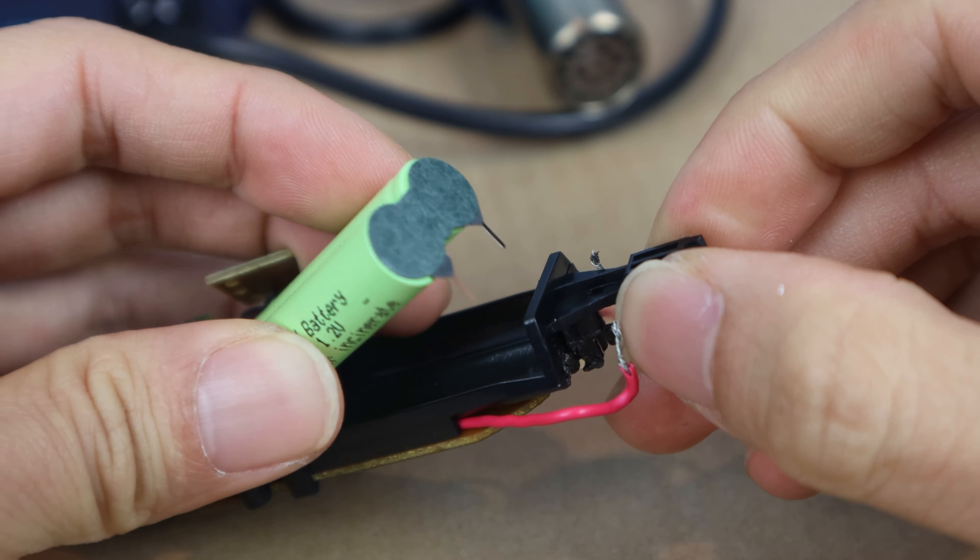So I'm going to put the new battery pack into the bay, and make sure the tabs go through the holes at the end. And now, because the battery pack is reversed, I'll have to attach the wires on the opposite sides like so. Just make sure you attach the black wire to the negative terminal's soldering tab, and the red wire to the positive terminal's soldering tab. First, I'll pre-tin the tips of the wires, and you can see that I've taped the batteries in place so that they don't fall out while I'm working on them.